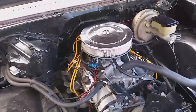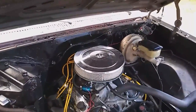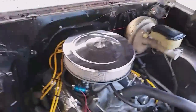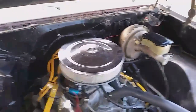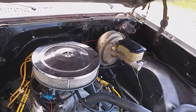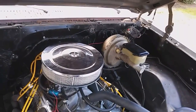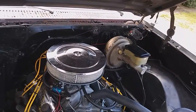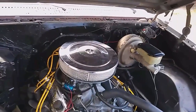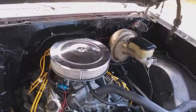Okay everybody, there's another episode of Double Duns Garage — this is the ignition issue. I'm pretty sure it's ignition, meaning that when I get on the gas it seems like it is cutting out — not the entire engine though, just maybe crossing up a couple plug wires or shutting off a couple of plugs. It seems like it's not getting to high RPM; it's extremely precise, that's why I think it is an ignition issue.